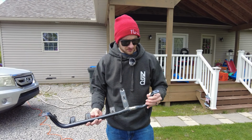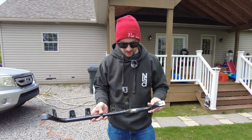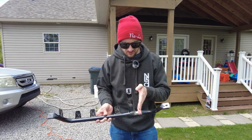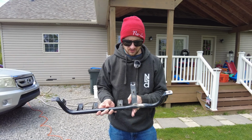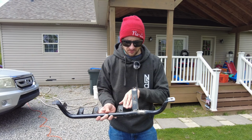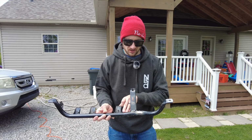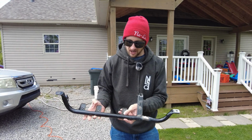Alright, so we were under the truck earlier, and you saw us jacking it up, and I ground a slot in this bar here, and we used the jack to bring it up to a level that matched this side. So everything across the bottom of the bar from the chassis is about 4 7/8 inch from the chassis to the bottom of the bar, which is what we were trying to do, create that level flat bar.